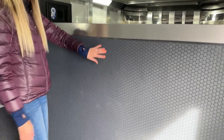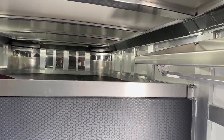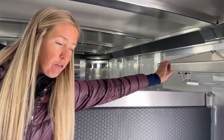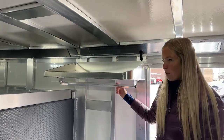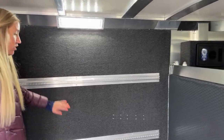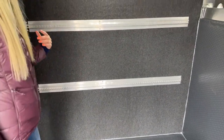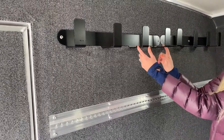We carried that gray rubber tread flooring all the way up our gooseneck drop wall and into our gooseneck deck as well. Right here we have a four-inch tube — it is removable — just to hold your stuff in there for storage. Over here we have our typical shelf with clothes bar, 18 inches deep with a two-inch lip and a clothes bar underneath. There's an AC frame up here if you want to add that. The two walls here are fully carpeted, lined, and insulated with airliner tracks to strap down show carts, blowers, or vacuums. Our partition wall also has utility hooks for hoses.